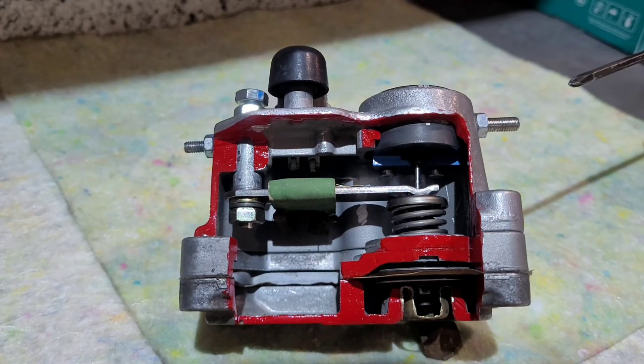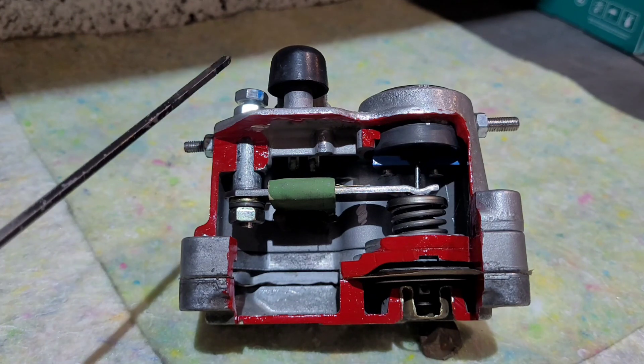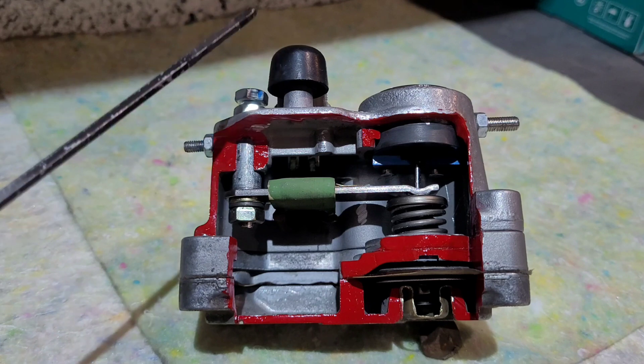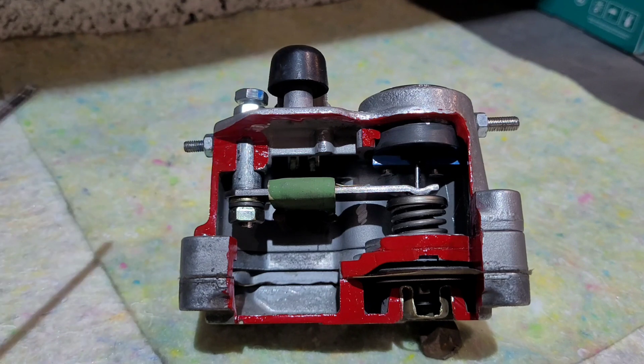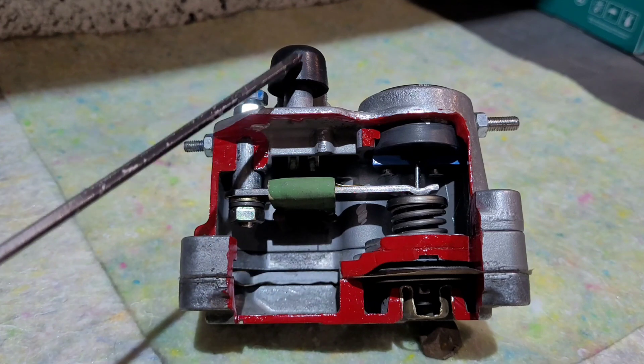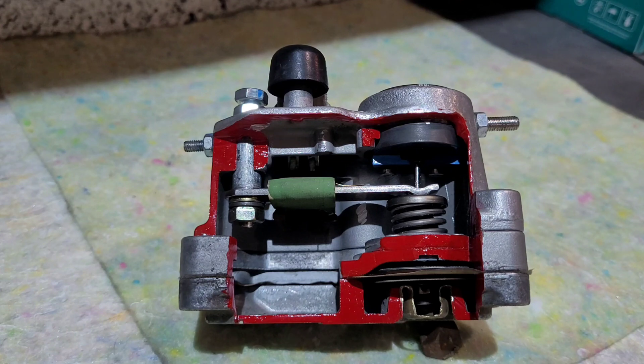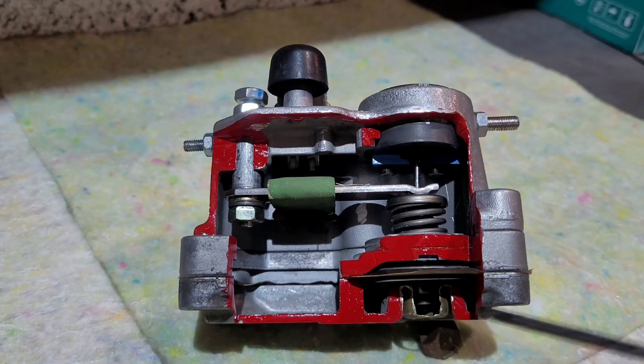Now what is this other port for? This is just a breather — it's nothing. I've had cars come to me with running problems where the main vacuum pipe is wrongly plugged onto it. This allen-key hole-drilling approach is an old-school way of adjusting them — and old-school means it should have stayed there, because it is not reliable. It's very precise and yet very unreliable to the point that tapping the body can change the fuel pressure. I can see how it works, but in the real world there's no need for it. Simple advance work on there is all we need.